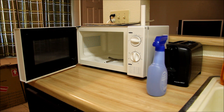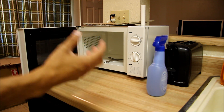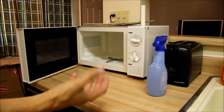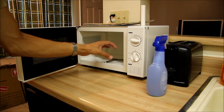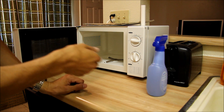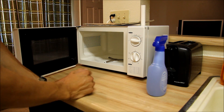I'm going to be demonstrating a way to visualize the standing wave patterns inside of a microwave oven. Inside a microwave you have a magnetron that creates microwaves within the enclosure. These waves interact with each other and have constructive and destructive interference. In some places the waves constructively interfere, creating a standing wave with a high intensity region that's much stronger than other areas. Likewise, waves can destructively interfere, creating a dead spot with absolutely no heating because the waves are 180 degrees out of phase with each other.